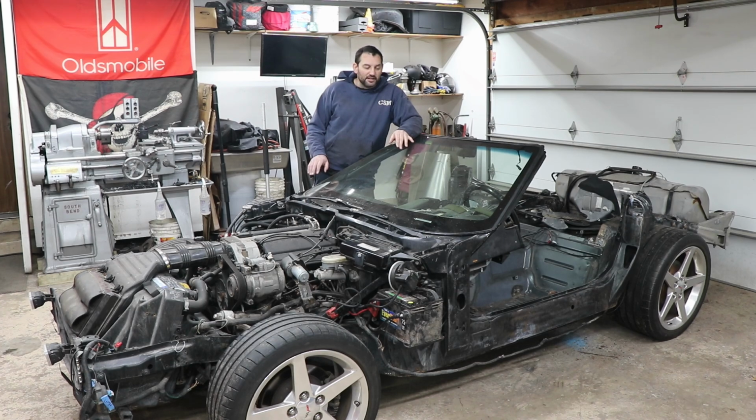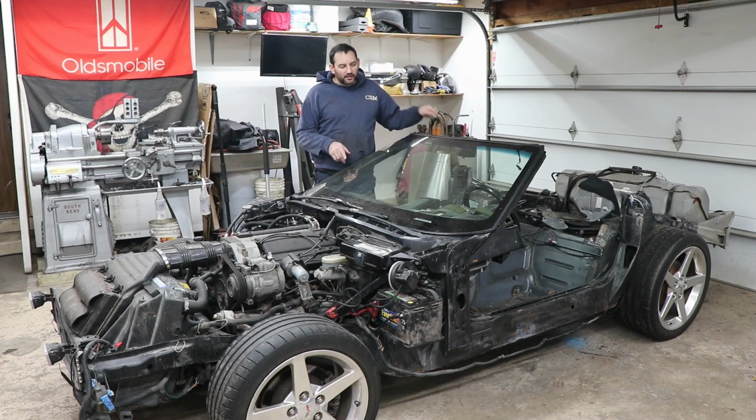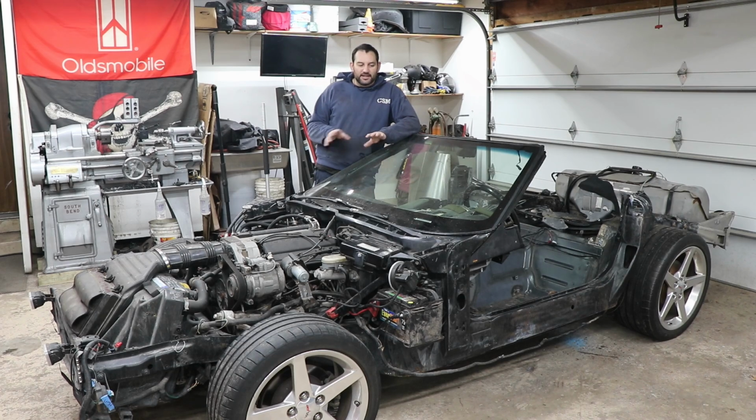But it's kind of weird because, like I said, with the key on, we're not getting any information displayed on the dash, like the mileage isn't coming up, or the digital speedo or any of that. However, it does sound like the fuel pump's coming on, which I guess for this, I don't know if the thing's a 93 or 94 or something. I'll have to double check, but it seems like if the VATS was reading, then that should make the fuel pump come on, but then I don't know why I don't have a crank and no spark or any of that when we was cranking.